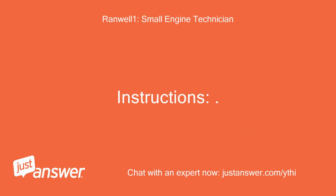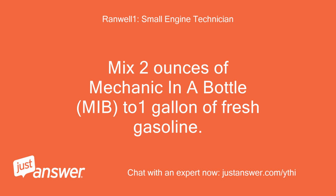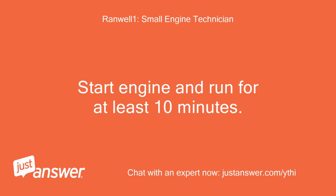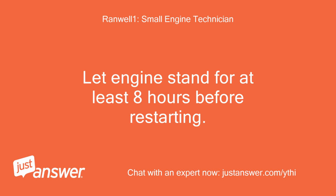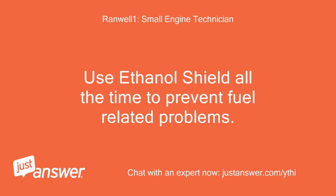Instructions. Poor running engine, no detrimental effects if overdosed. Mix 2 ounces of Mechanic in a Bottle, MIB, to 1 gallon of fresh gasoline. Start engine and run for at least 10 minutes. Let engine stand for at least 8 hours before restarting. Continue use of mixed MIB fuel until gone. Use Ethanol Shield all the time to prevent fuel-related problems.